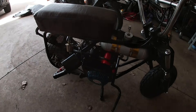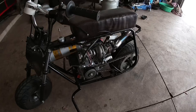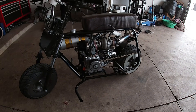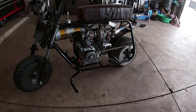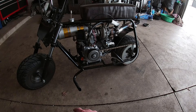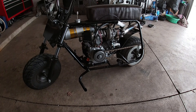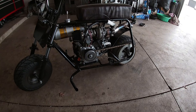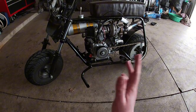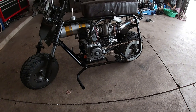We are back with the turbo minibike. Last video I had this out, it made like eight pounds and I bent a valve. So I went ahead and threw a built motor in — this is a 212 non-hemi, billet plus-40 rod. It had a flat-top piston; I swapped that for the stock dish piston so I could drop the compression. It's got a milled imported head, cam, billet flywheel, billet rod — the whole nine yards. I figured this would be a better motor.